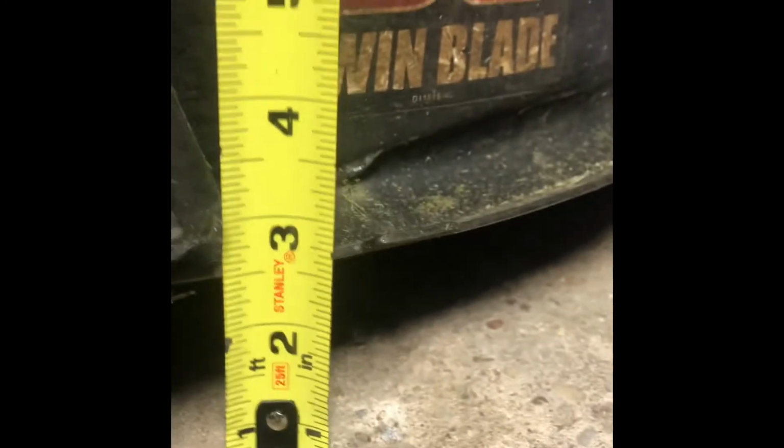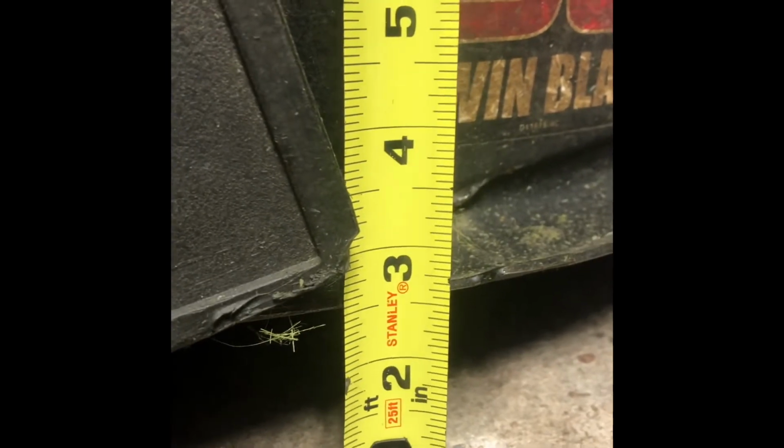I'm showing you right now the height I have on the left side of my deck. You're supposed to measure from the blade tips underneath it, but I'm improvising to show you on this video, and it's going to be close enough. The deck should be fairly even all the way around. Just to give me a rough estimate, I don't need it perfect. So, my left side was definitely high. I could see it was definitely mowing a little uneven.